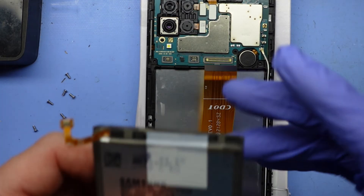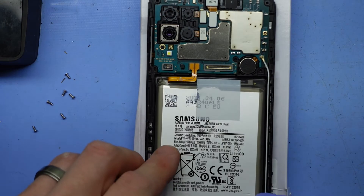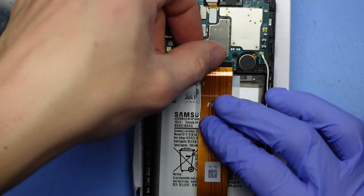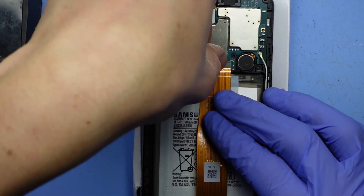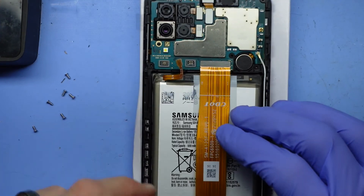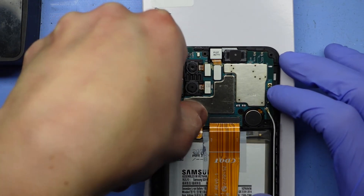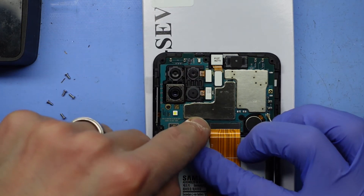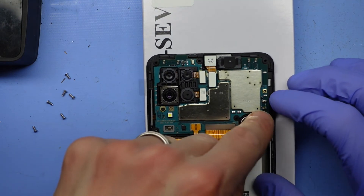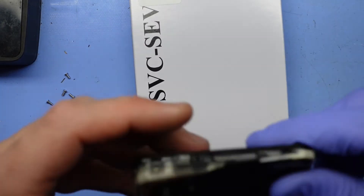Looking good. Usually what I like to do is reconnect the battery first — line it up, put the battery back in, and then disconnect it, just to confirm that no matter where you put that battery it's going to fit. Next up, put the flex connector back down: line it up over the top, wobble it a little bit and push down. The wobbling means if you don't feel any movement as you try and wobble it, it's typically located in the right spot. Now reconnect the battery — line it up over the top, wiggle it, push down to click. So we've got the antenna, the cable, and the battery connected. Now we need to put the black screw back in, then we'll be right to put these covers back on.